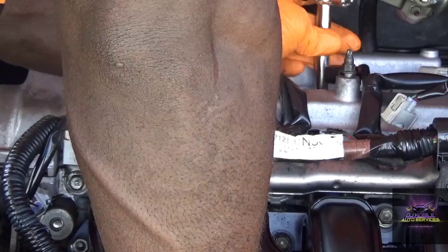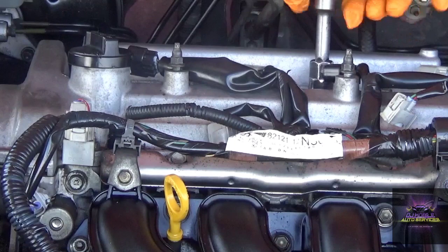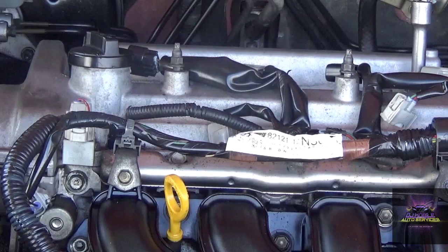Let's say it could be cylinder wash. Could be. You know how as we're cranking, the compression is building back up. Matter of fact, I might just swap all these plugs also while I'm at it and see what's up. I'm just putting it back in real quick just to do this test, but I'm going to swap these plugs out.